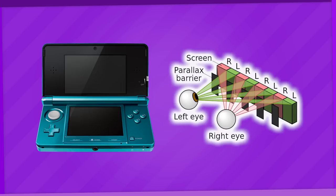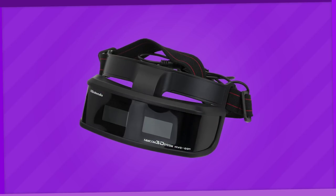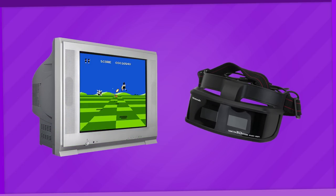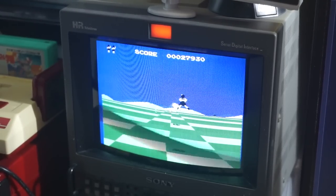This is just begging to have speakers plugged into it. Putting on the headset is pretty straightforward — you can manually adjust the length of the strap and fit it over your head. There's also plenty of space for glasses. Now while the 3DS uses a parallax barrier and the Virtual Boy just has two LED displays, the Famicom 3D System uses a pair of active shutters for its 3D effect, which means the TV screen alternates between images for the left and right eye rapidly, filtered by the shutter so each eye sees a different image, forming a three-dimensional image in your brain. This also means it would only work on a CRT screen, similar to accessories like the Zapper.